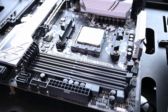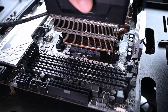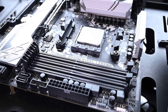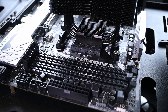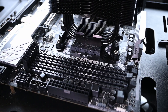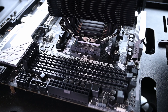Typically for AMD coolers like this Wraith Prism, it's a non-issue because the clip — all you have to do is get the clip in place, have the latch hook secured, and it's done. Even if you unhook the latch it's independent of the heatsink. Same with other third-party coolers, for example a be quiet cooler like this one — when you have the brackets ready, it's held in place by a piece like this. The retention bracket is separated from the heatsink.